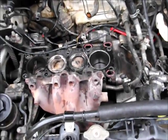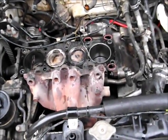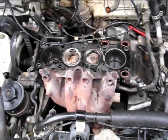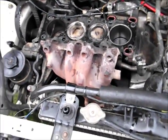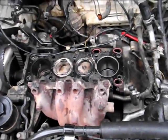If I was going to reuse this motor, I'd want to strip it down, pull the pistons out, get some new replacement stock-size rings. Of course you want to mic the bores and make sure they're not oval or tapered, but I guarantee they're not if there's cross-hatching visible. What you want to do is whack a hone down all four cylinders — hone it really thoroughly. You don't want to take material off, but you need the cross-hatching. What cross-hatching does is retain molecules of oil to lubricate the pistons and rings.